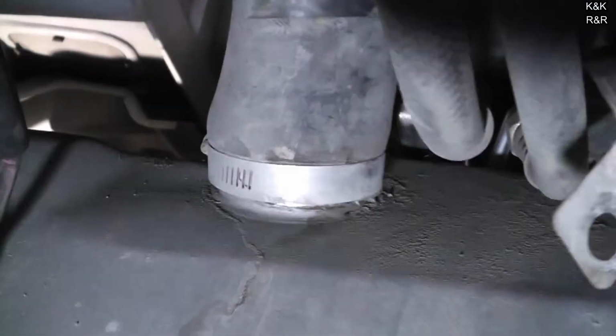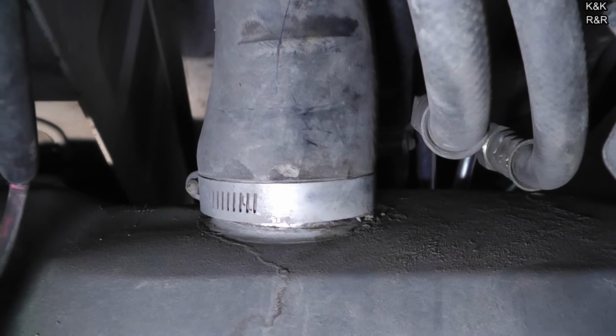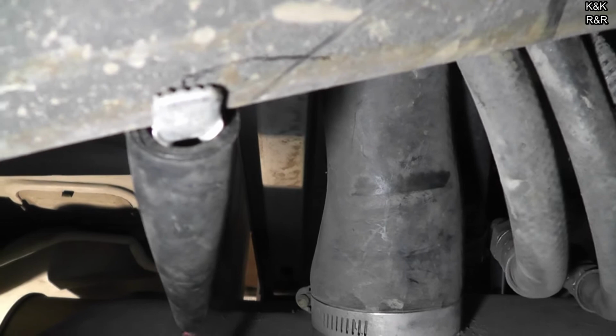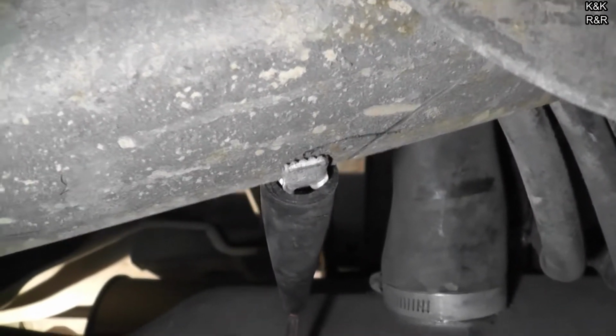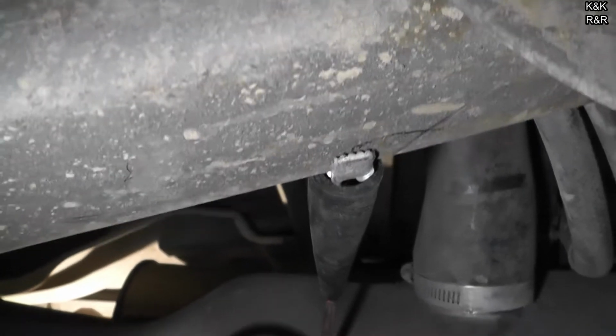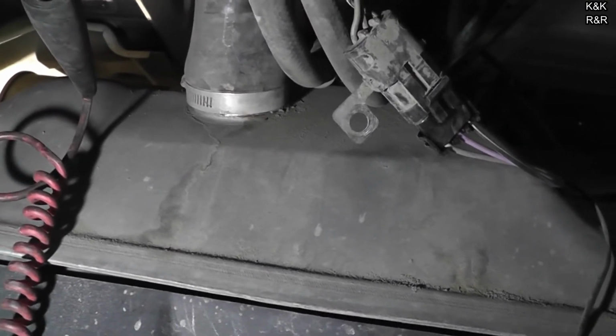I always test these because you just never know. Alright, everything looks dry. One thing good about dust is it's definitely a witness. But yeah, you want to definitely key test this, but if you don't hook that ground to a good location, it will not run. It'll make you think the pump you just put in is bad, so make sure you have a good ground. This is my trusty ground wire, but I had it in a bad spot. The hookup for the ground is actually on top of this frame, and then just run a jumper to your ground. And that's pretty much how you can do a test without actually having to sling this heavy tank back up in the hole. Other than that, we are ready to go.